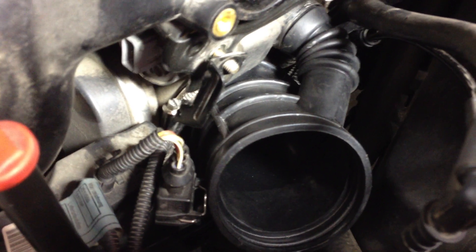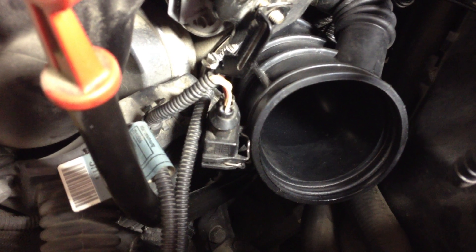The biggest problem with this intake setup is the engineers have sort of half-assed the situation — there's a small intake here that goes to your idle control valve and it comes off of this primary air intake. This rubber gets hard with age and cracks begin to appear. The engine moves in the engine bay, and so does the intake boot as people change and replace their air filters. This continual flexing as well as the heat of this area causes cracking to happen.